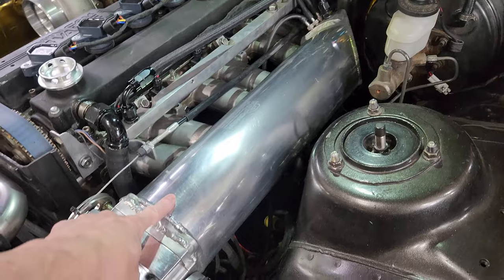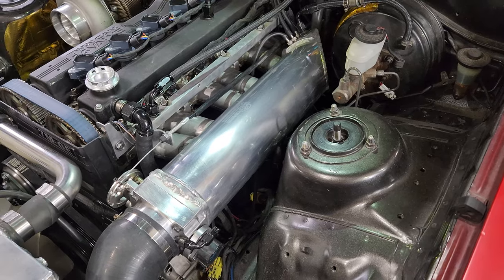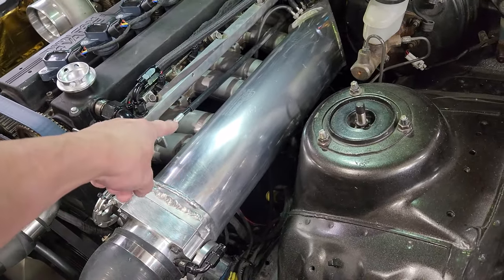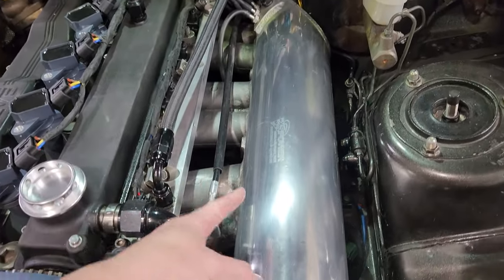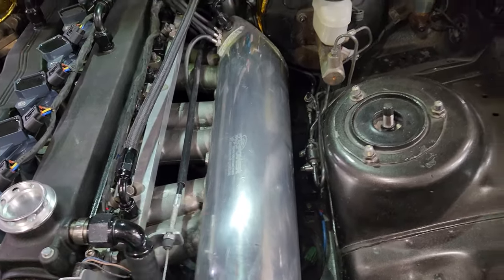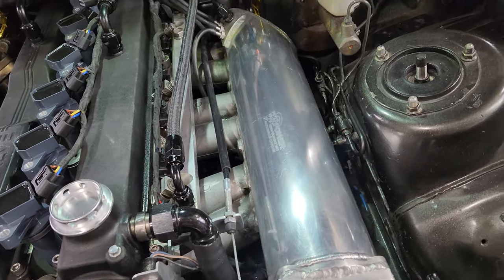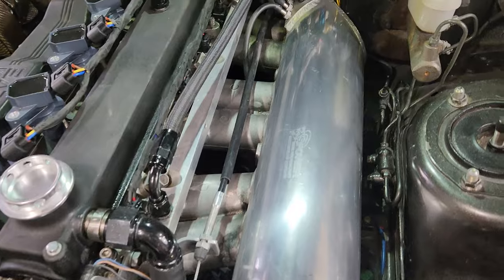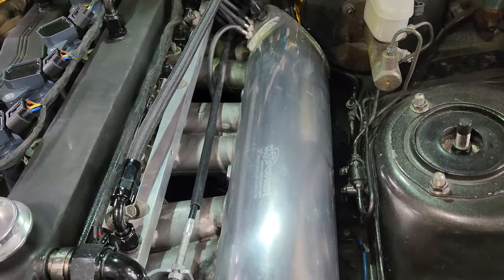This was a total guess before we even measured anything. I just got the pieces and we welded them together and it fits perfect. This is the XS Power Sports plenum — they advertise it for the IS300 with the 2JZ-GE in it, supposed to bolt right onto the 2JZ runners. In my case, we took the 7M cast runners and welded them right to the plenum. We had to do a little prep work — it was a trick to weld the cast to the sheet aluminum, but we got it to work out just fine.